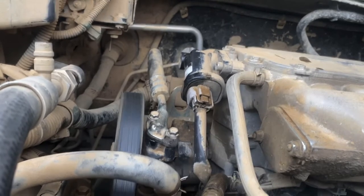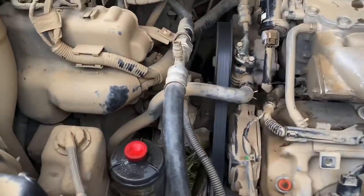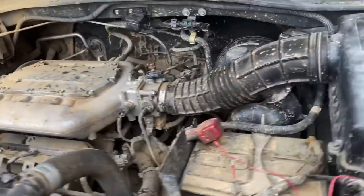Oh my God. And there it is. While it's running, it's at the low level — the sound is gone. I'm excited about that. That was an easy fix. That part was $10. The power steering pump is like $250, so it's fantastic that that fixed it, at least temporarily. We'll see how long it lasts — I'll keep you updated if it goes out again or if the fluid goes lower or anything like that.